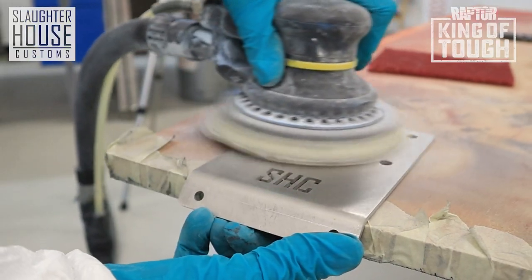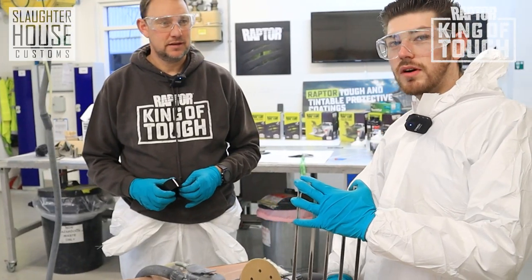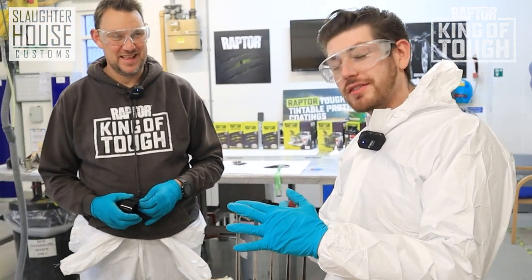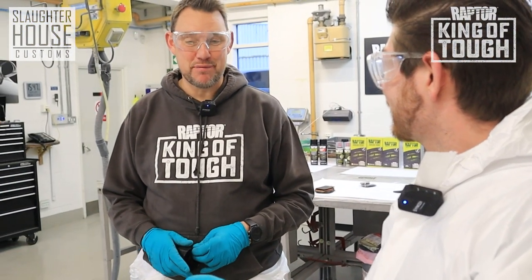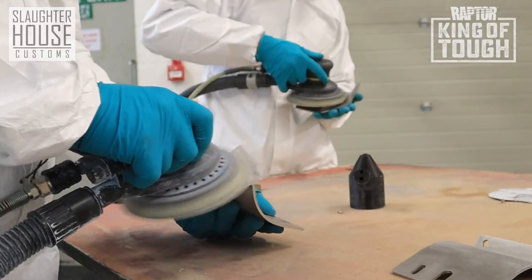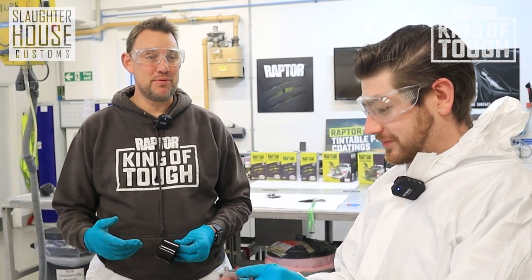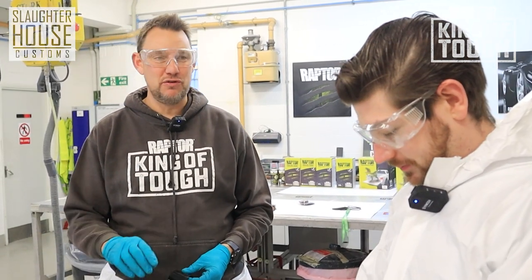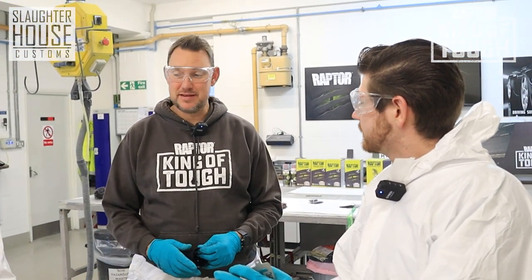Right, so let's get this sanded then. This is why I'm not allowed near the paint booth — I get impatient with the prep, and that's why Jono is here to do paint for us. As with most things in painting, it's all about prep. Probably 99.999% of complaints that come in from end users, when we go back and have a look, it's down to prep. It needs to be cleaned, it needs to be abraded, it needs to be cleaned again, then you use the appropriate priming system before the Raptor. Once you do that it's bulletproof — it's going to be on there for a long time. Prep, prep, prep. De-grease again.